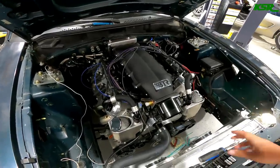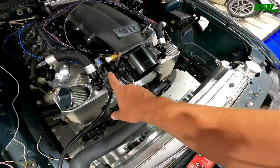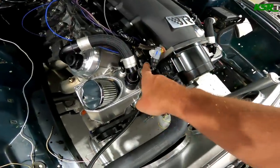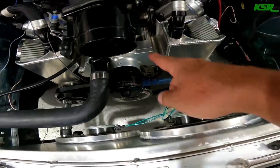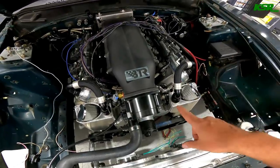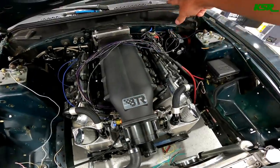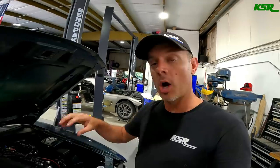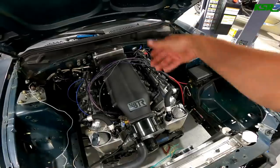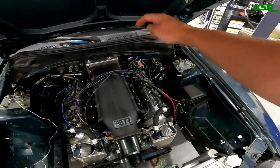Now that I've made a good mess, we've got all our sensors wired: TPS, IAC, manifold air temp — though I forgot the pins for that so it's temporarily done — MAP sensor, cam sensor behind the water pump, and coolant temp. These are laid out right now because the cam sensor wire runs all the way back under the intake to where the plug is going. I'm going to pull everything out, confirm the cam wire length is sufficient, then finish heat shrinking and looming the whole bundle outside of the intake.